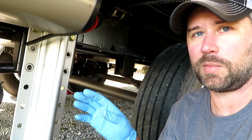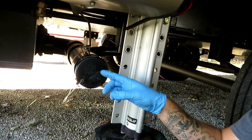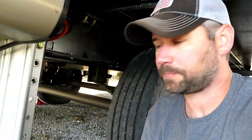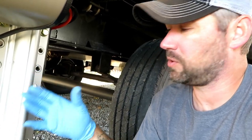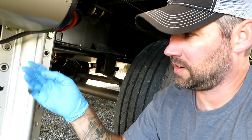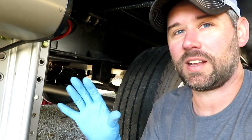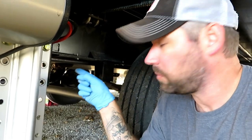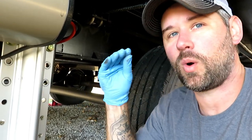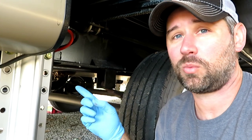For the jack on this side, I already got most of the bolts out. Because we're working so close to the tank, I went ahead and disconnected the stinky slinky and capped it off. I always wear my gloves just in case — if I hit this wrench and knock that cap off, I don't want to take any chances. The middle one on this side also can only go up one notch, but again I think one notch is going to be plenty for all of these.